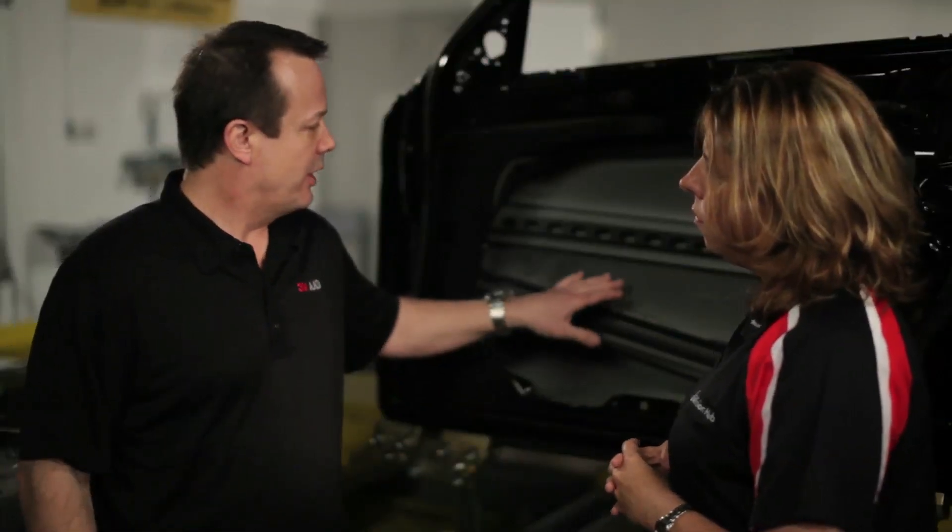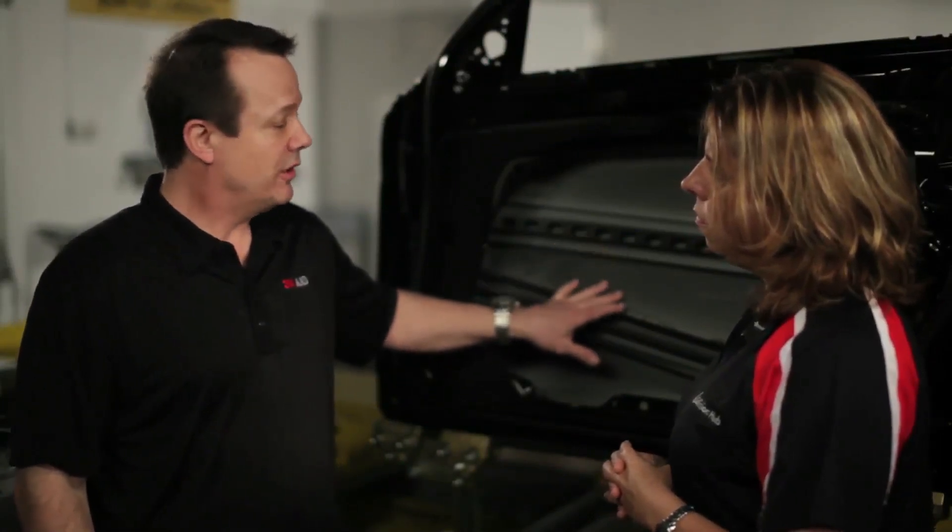Now, I'll go into a shop and I look and there's maybe the C-Tech or someone who's just come out of tech school — and he's the door skin guy. It seems like every door is laying on its back on an old parts stand, face up where you can see the inner workings of it. That's going to cause problems. It's really important what we do with this door skin after we apply our foam. Once we have the correct products in there, it doesn't do any good if we then set the weight of the door down on the skin as it's being jammed in the paint shop. If it's up to me, I would wait until after the door is already finished and on the vehicle, and then install the foam while it's in a vertical position — and then you're not going to have that problem.